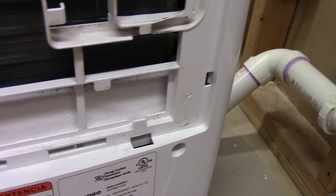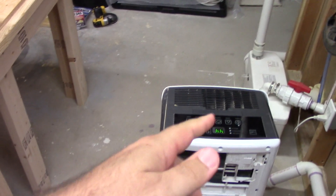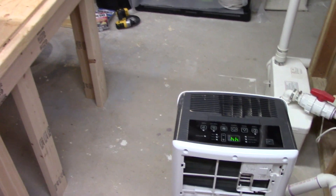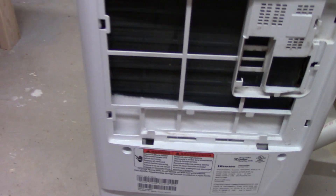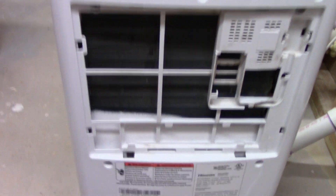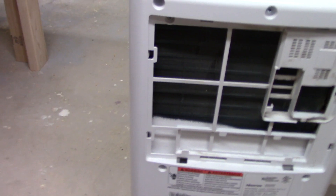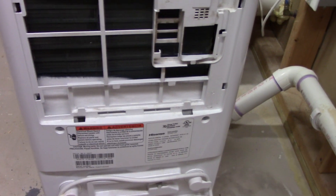Let's hook off the back panel. And there you have it, guys — that's all ice. Pretty amazing, huh? So let's just recap here: dehumidifier was about two years old, the pump goes bad first, and then the refrigerant leaked out. You have to laugh at this lack of quality sometimes. Look how high this ice is building up — it's crazy. Here are two images showing the remnants of a puddle on the floor, where the ice buildup wasn't just on the coil but also outside on the plastic casing.